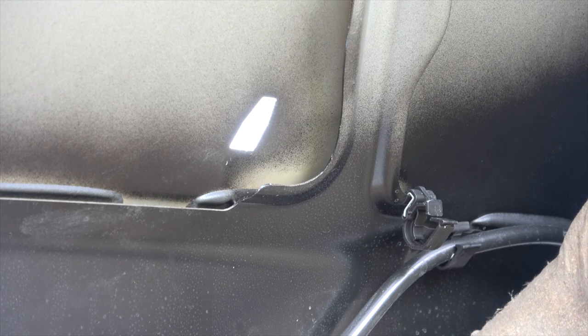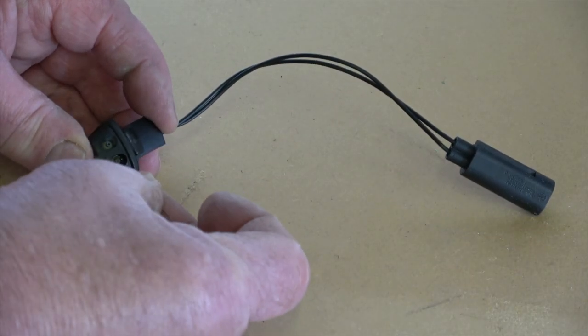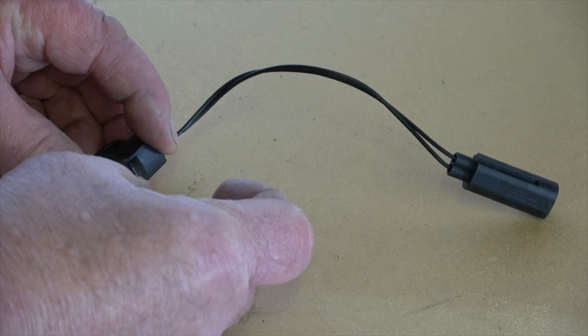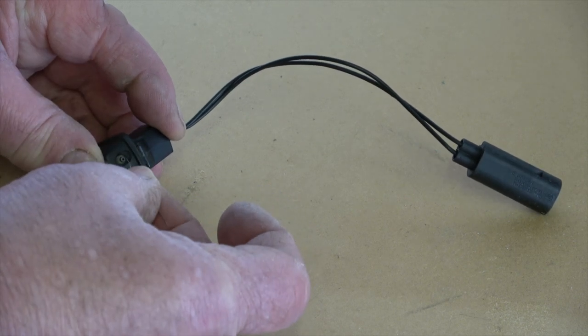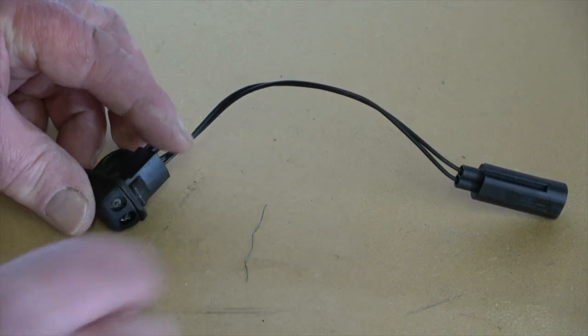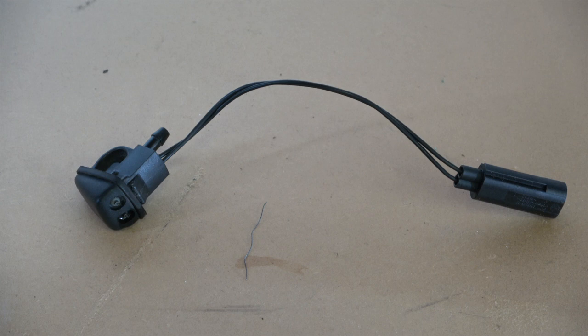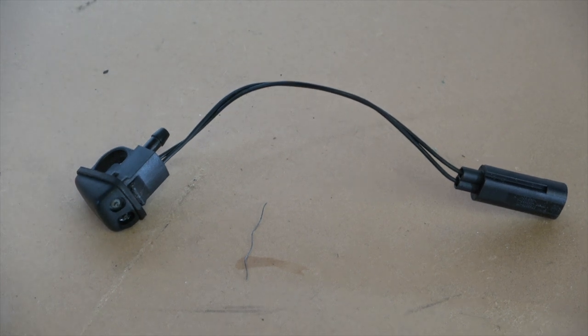Now all we need to do is clean the nozzles. Here is the offending article. You can clean these things out while they are still on the car, but it is easier to just remove it so you can flush it through. You can clear the jets with a little piece of wire. I use a piece of wire just to poke out the nozzles, because this one was quite clogged. If your eyes are good you can get it in there — give it a good poking — and then flush it through with air or water. Connect the water supply up and just blow it out.